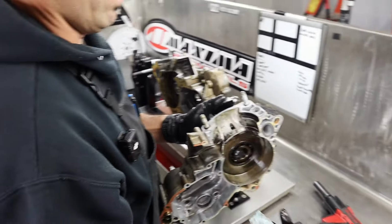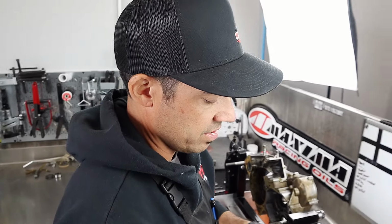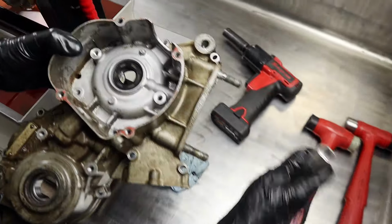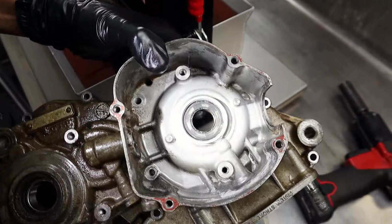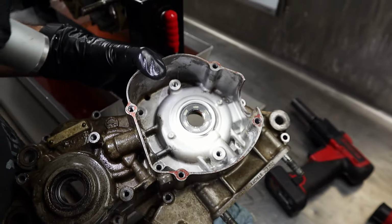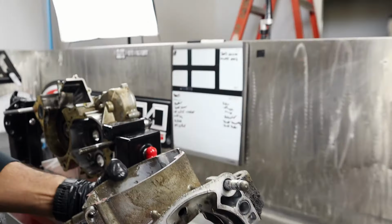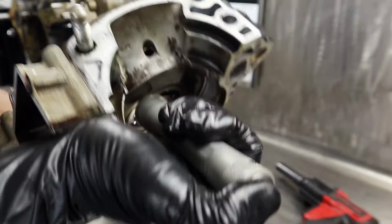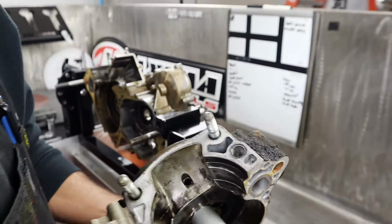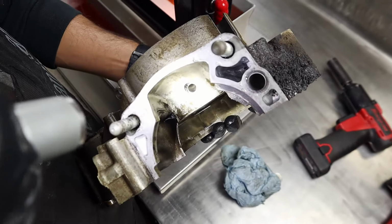And the connecting rod bearing felt great. Yeah. So I know that's getting adequate lubrication. This bearing was my concern because of this seal. When the seal is in too far, you can see the machined surface, it's beyond. It's supposed to be even with that or even just a skosh above it. You'd be blocking that oil port, this guy right here. So if you push that seal in too far, pull it out and sacrifice it and get another one. Because what will happen is you'll plug that oiling port right there.